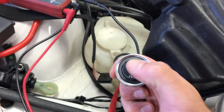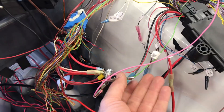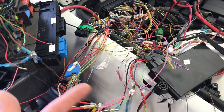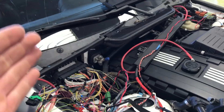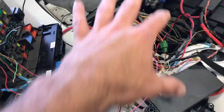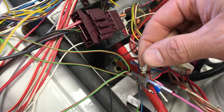Making progress. We have a red and a green power wire that comes from the CAST and needs to be powered — I have it hooked up to positive power, but it'll eventually end up getting hooked to accessory power. Every single one of these units is connected to a green with a red stripe — that is called the wake-up wire. It basically turns on all the units when you turn the key to the on position, which is what we're going to do on the E36. So that's going to end up hooked to ACC, but for now we hook it up to positive battery. It needs a 12-volt wake-up signal to activate all of these items.